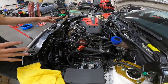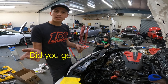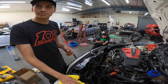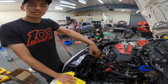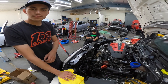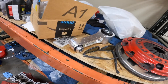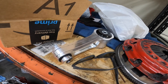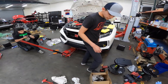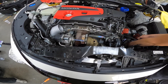This kit comes with three mounts. There are plenty of videos on the rear motor mount — it's pretty straightforward, just two bolts and you pry the engine back and forth. We already have it installed so we're not doing that one today. I'll give you an idea of where it's at when I show the front pipe rewrap. Your car is not going to look this torn apart — I'm just doing four things at once today to condense the video.